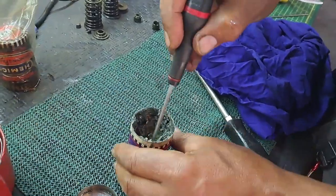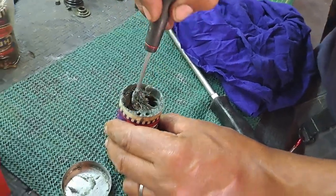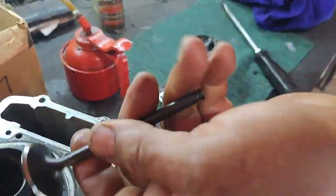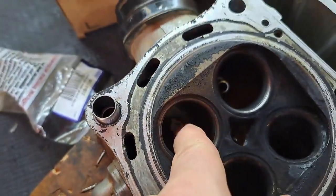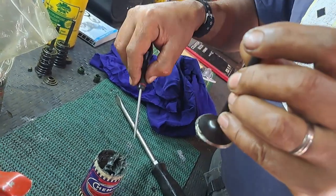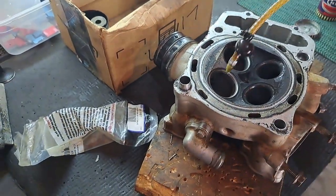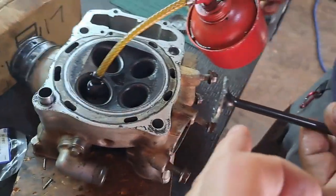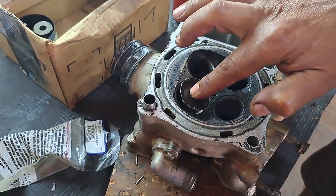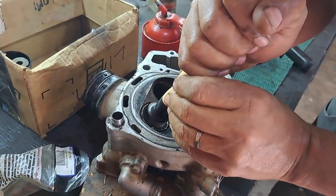We've put a little bit of engine oil in there to lubricate it, making it a nice paste. You're not allowed to get paste onto the shaft, because it will be abrasive and it will scratch up the valve shaft. The purpose of this procedure is to try to mate the surface of the new valve with a fairly abused seat. This primitive suction cup tool is the best plan - it works, it's just annoying.